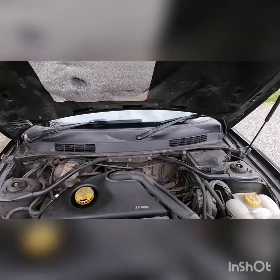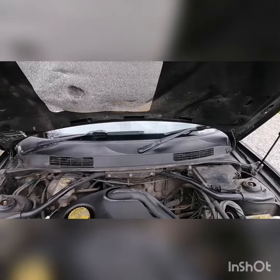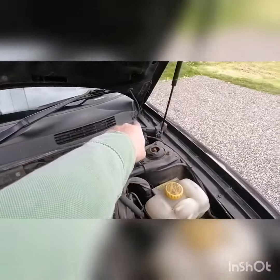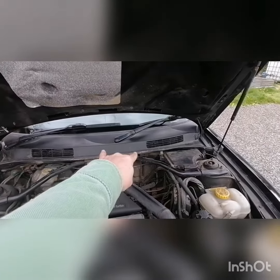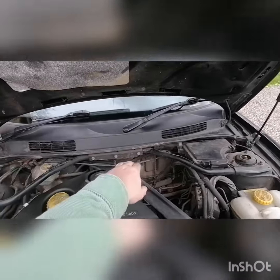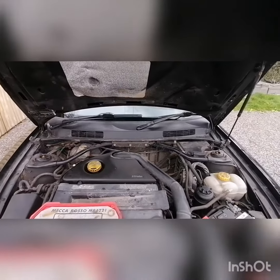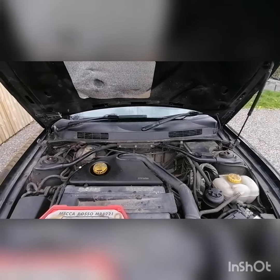That's it, all back together. I'm not sure how instructional that video was, but to recap: I took the two wipers off, pulled the seal off, got the plastic cover off without disconnecting the washers, then removed the second plastic cover underneath. There are two clips holding the cabin filter — I took it out on the right hand side, put the new one in, and reversed everything. Hopefully it'll make a bit of improvement to what's coming inside the cabin. So there we are.